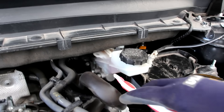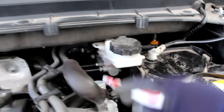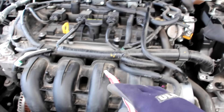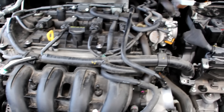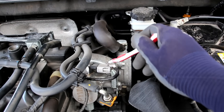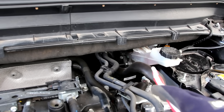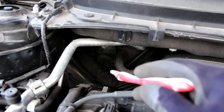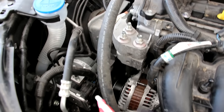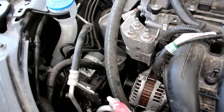Taking a look at the braking system on the CX-5, it uses a traditional style master cylinder with a vacuum brake booster. If you follow that vacuum line off the brake booster it actually goes to a vacuum pump — because these Skyactiv engines don't have enough vacuum inside of the intake manifold to generate enough pressure for that vacuum booster. It also forms part of the housing for the direct injection pump so these are all powered off of that exhaust camshaft. On almost all new cars the brake lines run from the master cylinder over to the ABS module, usually situated in a very nice safe spot, but Mazda has chosen to run all those lines back out to this other side to the ABS module which controls the traction, stability and any autonomous braking features on this vehicle.